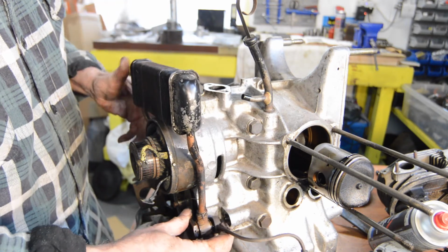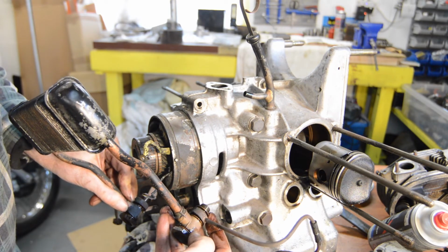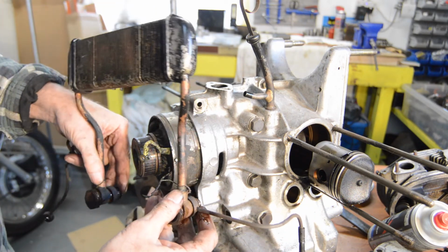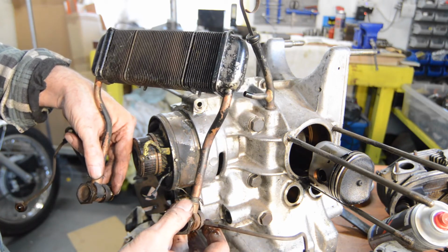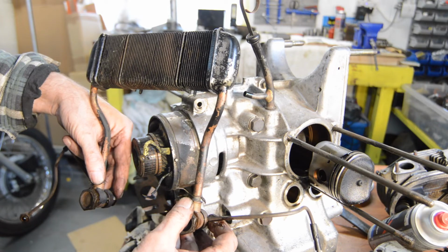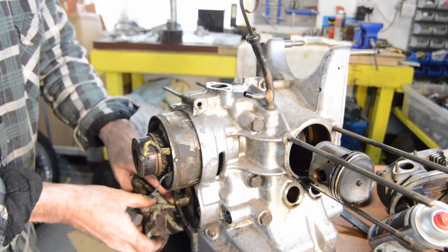And that's our oil filter, oil cooler. So copper washer, head feed, copper washer, oil cooler, another copper washer, big bolt, lock wired on. So that just needs cleaning out because there's no signs of leaks. All the finning is in lovely condition, really untouched. And also no muck in it. So that's good, that will clean.